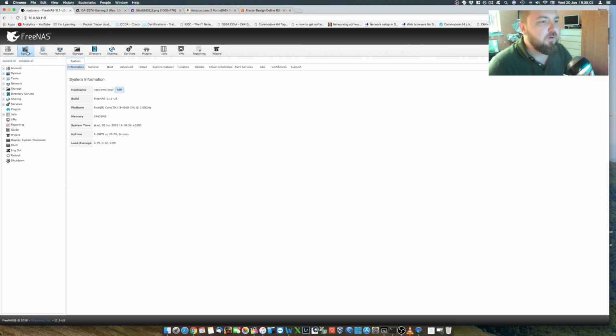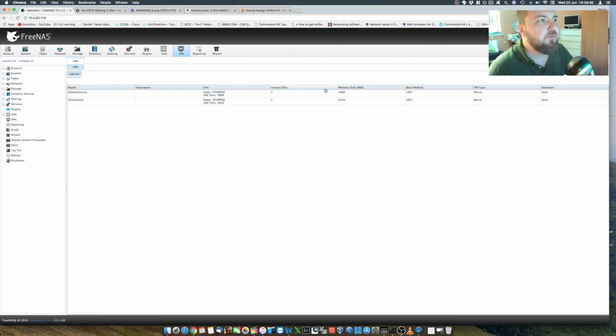So I would like to go through specs for a small moment. As I said, we are using here a Core i3. It's a Haswell, so it is a 4160 at 3.6 GHz. It's the cheapest possible dual core processor with relatively high clock speed I could get. That paired with 24 GB of RAM should be enough for 16 TB of storage. How I'm going to divide that storage is yet to be revealed, but it should be enough regardless of what I'm going to do, and that will include also 2 virtual machines.